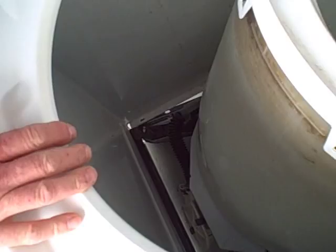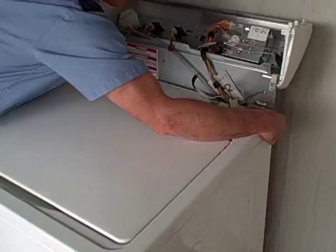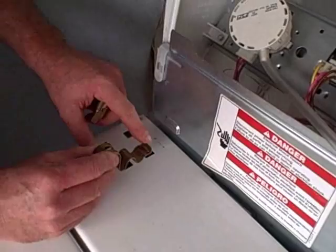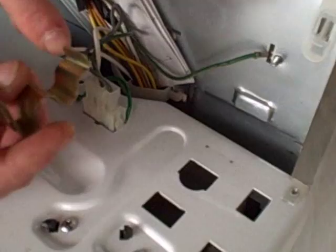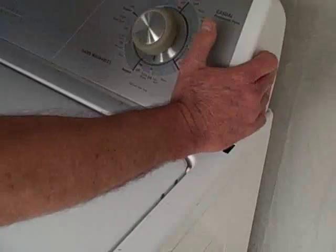To install the body, lift the lid, grab the machine, put it on your knee, swing it around and bring it into position. This is important — line the white bottom rail up and under the machine, then the black rail, and drop down into position. Pull your back forward, drop it on top, and lock everything up. Connect your connector, grab your clips and put your clips in position with the lip underneath the back. Clip under the back, clip into position and push. Close the lid, slide back a quarter of an inch, reinstall the screws, and you're done.